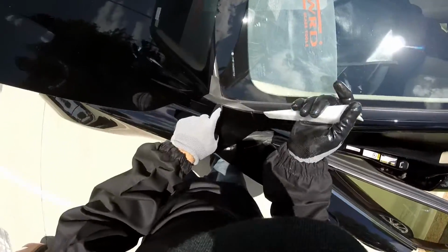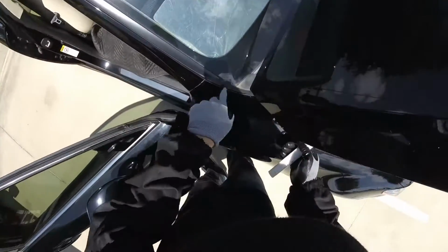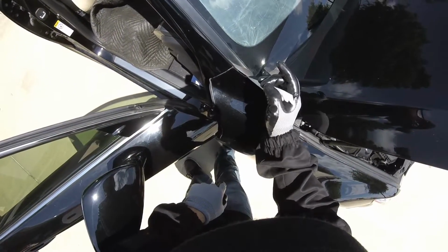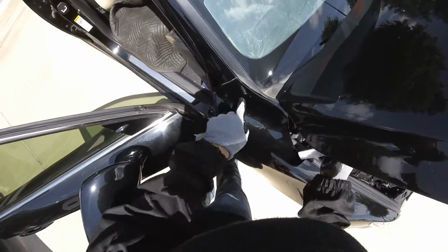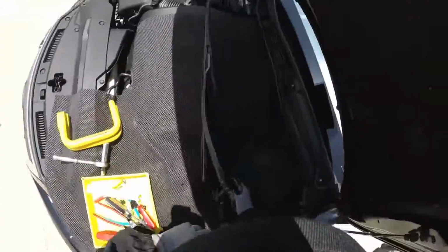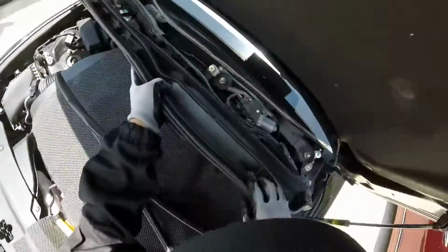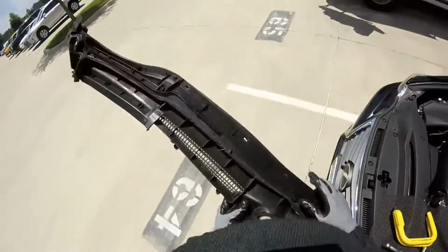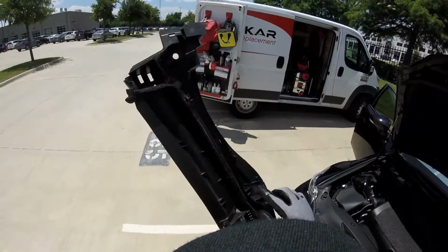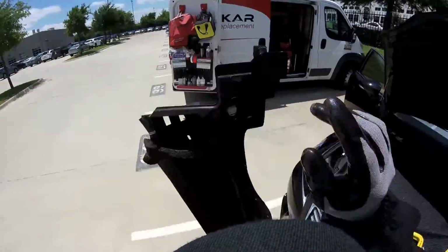Okay, you're gonna just open these corners right here. Careful, because this thing is catching the metal, so you can break this one. You see this one is open, you see the gap right there, or you can get damage on this part of the fender. So careful there. And remember, grab your molding from the middle, shake a little bit, and pull it. In that way you don't break any of your clips. You see it? It's got hooks and clips.